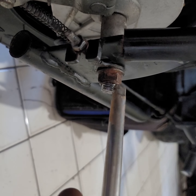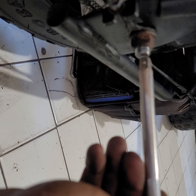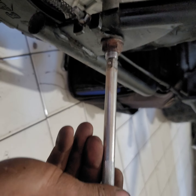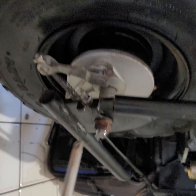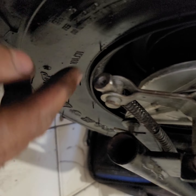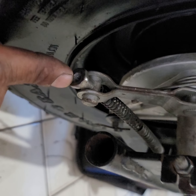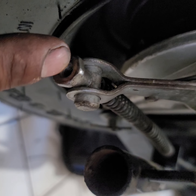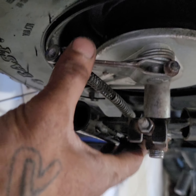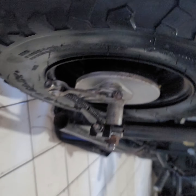After that, take this off. Take the bolt back off. Sit this here as so and hit that in all the way through. And this thing should be able to push it all the way through and it should shoot out the other side. Hit it hard right there. As you can see, my screw adjustment is not that far in. As you can still see in the inside of that hole, I just got it a few turns because the brake band is so new.